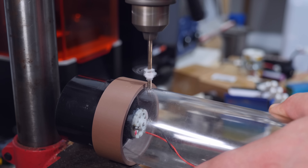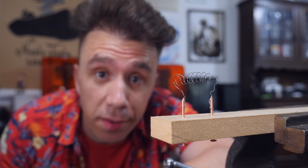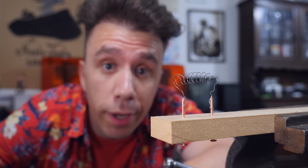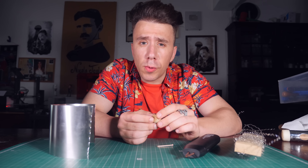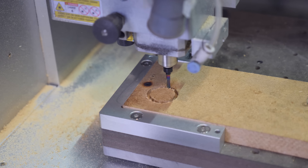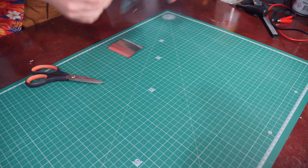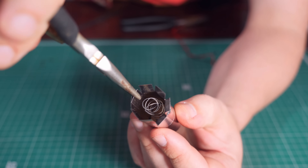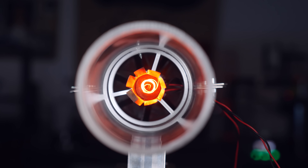Where'd it fit? So, I just measured the exhaust speed of this setup with just the fan using my wind meter, and I measured about 4.5 meters per second. Let's see if we can make that value a little bit better with combustion. Now I need to build the igniter. I assembled a simple setup with two copper nails and a bit of nichrome wire from the air dryer to see how much voltage I need to actually ignite the brake cleaner. The igniter is running hot even when the fan is running, which is great.